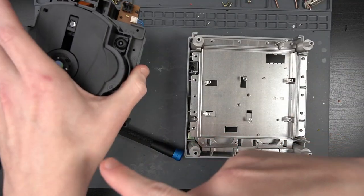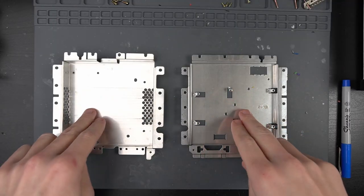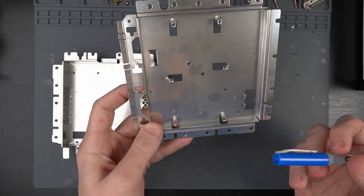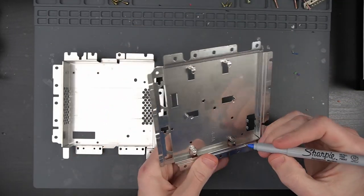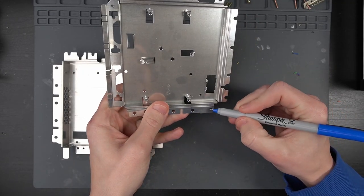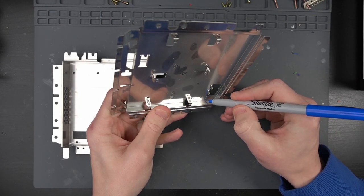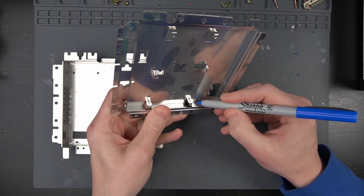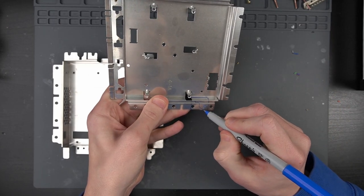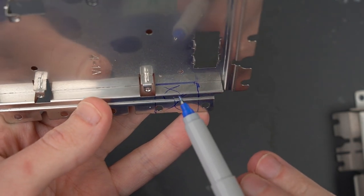Make sure you put the disk drive up like this. You can put everything else aside and just get your two shields out. We're going to need to modify both of these shields to get the flex cable to fit. I'm going to use a sharpie to outline exactly where we're going to cut. Let's work on the bottom shield first. We're going to make a cut here, removing this screw hole, ending right about here, and cutting a notch in this part of the shield all the way to the bottom. Everything I've put X's on, we're going to notch out.